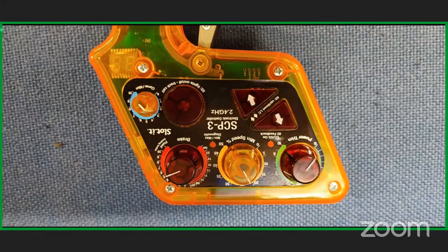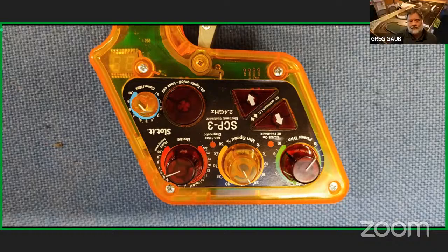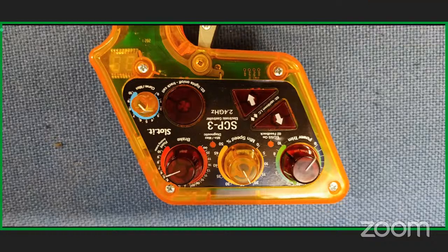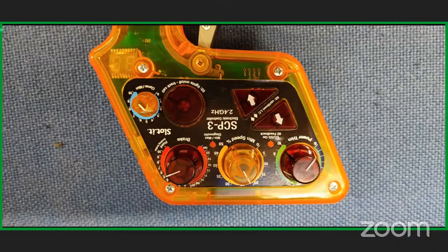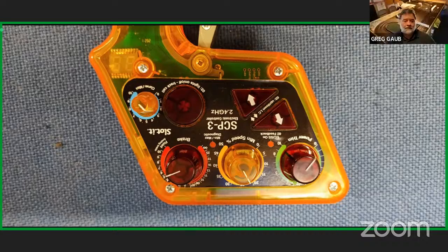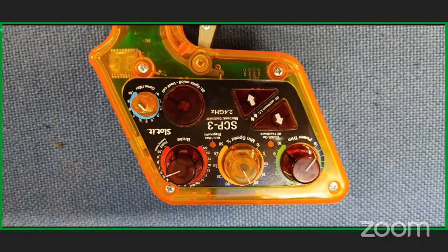But then again, that's all based on the weediness of the motors that we're using in these circumstances. We're working them really hard. We want everything. And it's Ninco track. And were the tires stock too? No, the tires were a handout BRM F22 tire. Okay. 20 by 10, I'm going to gamble. 20 diameter, yeah, 10 wide. F22 compound on Ninco track. Yeah, sure. It's adequate for this kind of car at this kind of speed.